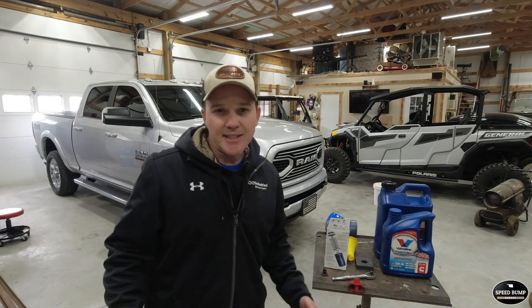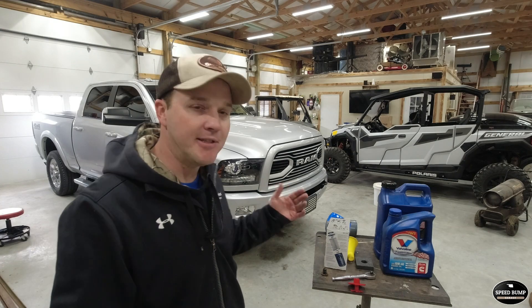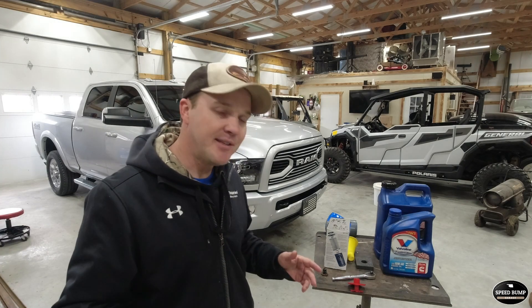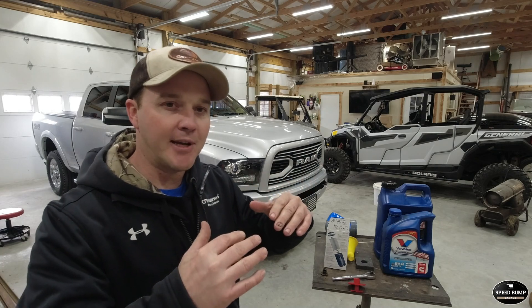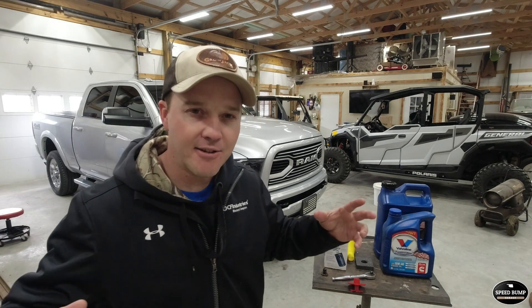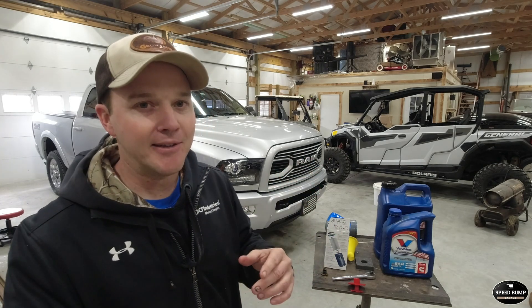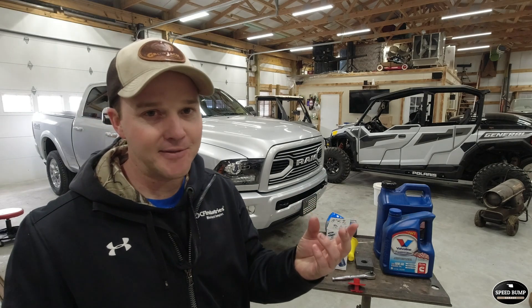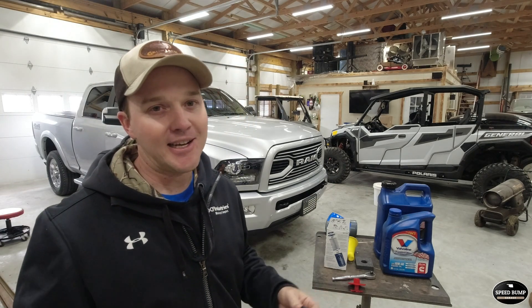Let's get into the actual oil change. I already drained the oil on this, and something to keep in mind: the perfect time to drain your oil — whether on a Cummins or whatever you're working on — is when it's warm and has been running. If a vehicle's been sitting for a long time, all your debris and wear metals that are heavy go to the bottom of the oil pan and lay there. When you pull the plug, you may not get them all out. So circulate that oil, get the engine running to get all that bad stuff suspended, then shut the engine off and pull the plug — and hopefully all those bad particles will come out with the oil. Keep in mind that oil will be hot, so have a good pair of gloves on and be ready to get out of the way once the plug is out.